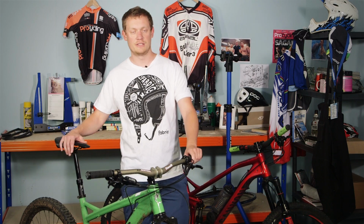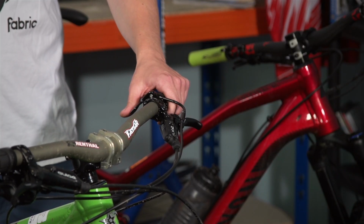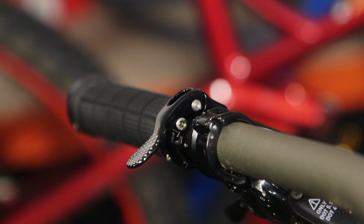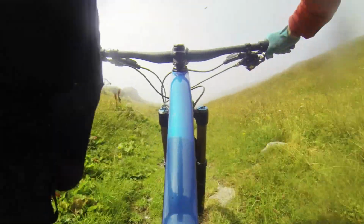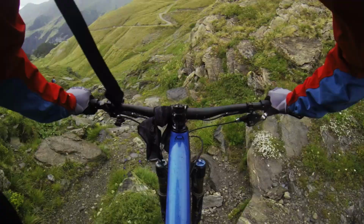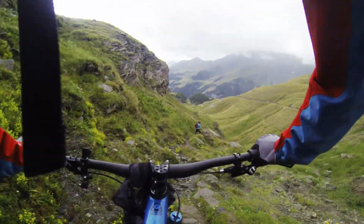So one of the nicer things about the IRCC is that in the box you get 2 different lever options. The vertically orientated lever which comes in the box is really nicely shaped. It's got a good thumb paddle on it and a reasonable amount of length, which gives a good bit of leverage to pull the cable through the full length housing, which can be a bit stiff at times. The other option is what they call the SRL, or the single ring lever. It's shaped much more like the thumb paddle from a shifter, so it goes in the more horizontal plane. And again, plenty of leverage, and it's a really nice lever setup.